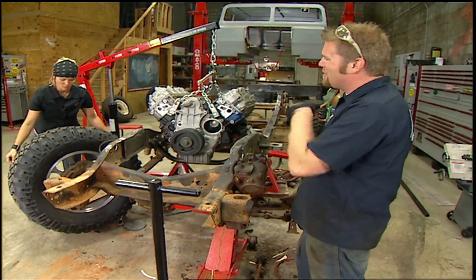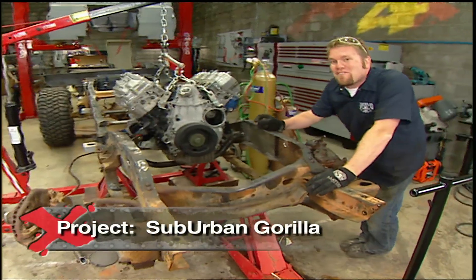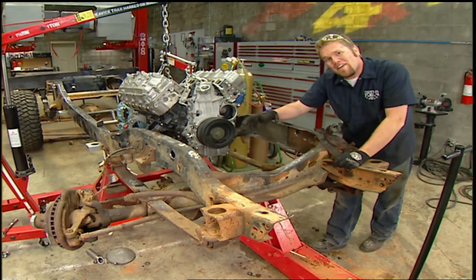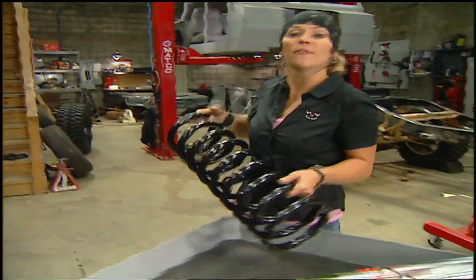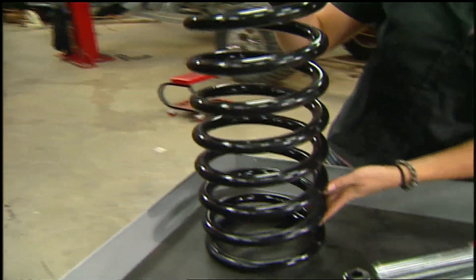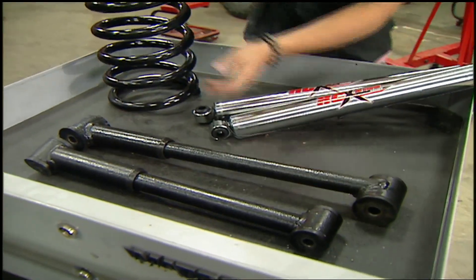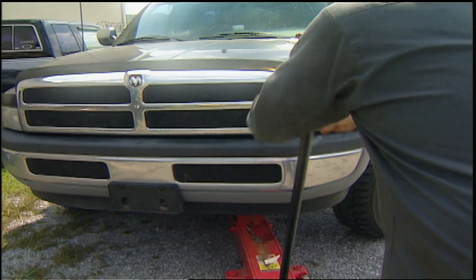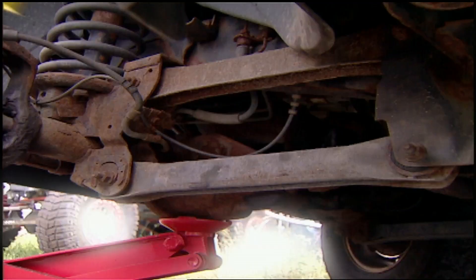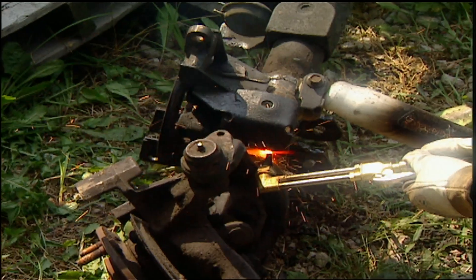Welcome back to Xtreme 4x4 on our Suburban Gorilla build, or SUG for short. With the frame boxed for strength, we can turn our attention to the front suspension. The donor truck is an 87 Suburban, and K-Series trucks have solid axle leaf-sprung front axles. Although they're great for strength, the ride on the road is not that good. So we decided to convert this truck to a coil spring front axle using a Panhard and a 4-link. We're going to be using 5-inch lift springs you'd find for a Dodge truck, a set of 5100 series shocks per side, and a set of control arms, all from Rough Country Suspensions. When the big three automakers scrambled to build better-riding four-wheel-drive trucks, most OEMs started building independent front suspension systems. Dodge stuck to their guns and refined the coil spring solid axle pickup. Since Dodge has some pretty good time invested in designing their front suspension, we're going to borrow some measurements as well as some parts from the junkyard.